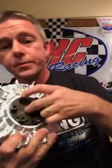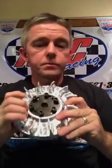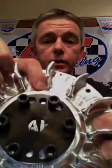With our adjustable flywheels, most of the time when you get an adjustable flywheel for any engine, it's going to come set at standard timing, whatever the timing is for that engine. That's where the first line is on here. That's your standard timing mark, for whatever engine you're putting it on. But that's why you always set the degree wheel up and use the paperwork with your magnets and your coil leg, and see where the timing is on your engine, no matter where that hub is set. That way you know you've got it set where you want it. Same thing with the non-adjustables.